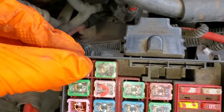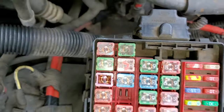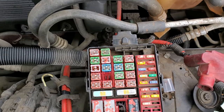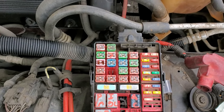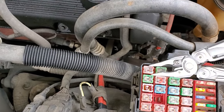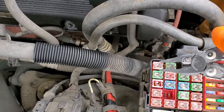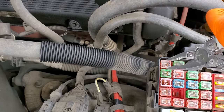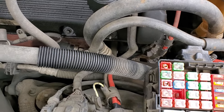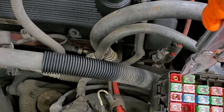You can actually look down through it to see if it's blown or not. This one is intact. Now as far as removing it, it's real simple to do, although it is hard to do without damaging the top of the fuse. You basically grab either side of the fuse and you're going to want to wiggle it while you pull straight up. Don't be alarmed if the plastic piece just snaps off or breaks — happens all the time.